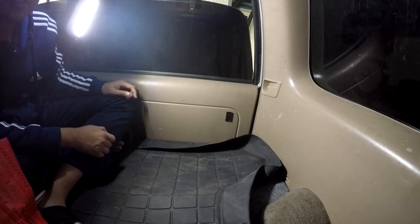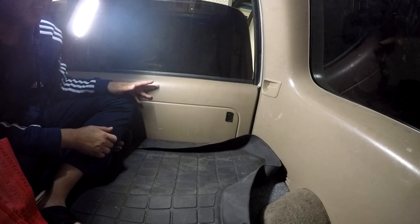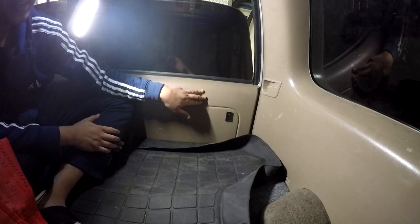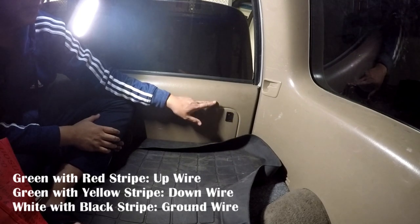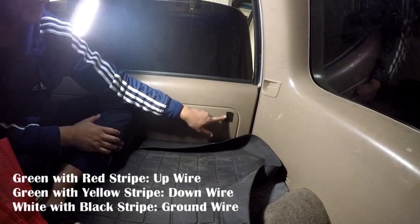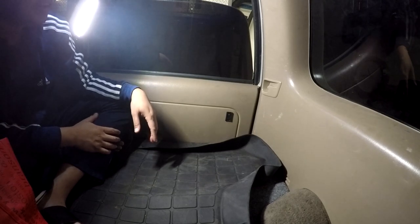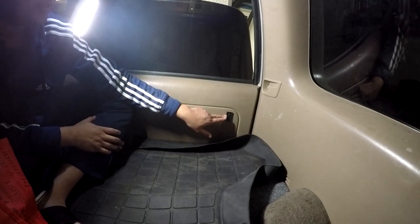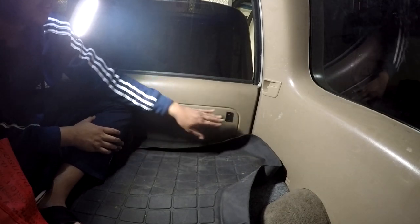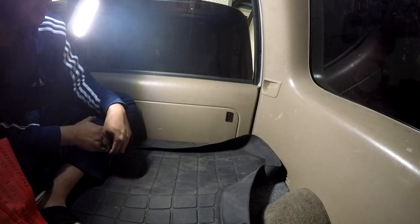Make sure the panel is back on before you test it. For the most part, you shouldn't have to test it much — I've given you all the wire colors already. If you're really paranoid, make sure the window is pushed backwards away from the car, because it tends to lean toward the front and that's what causes scratching. To summarize: just use the same wire colors I used, skip the multimeter if you want, tap into the same three wires — the ground, blue with red, and blue with yellow — wire them correctly, and you should be good. You don't have to put your switch in this exact spot; just know there will be some clearance issues wherever you go. If you like the video, please like and subscribe, share, let me know if you have any questions, and see you in the next one.